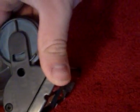And just a little note, I figured it out pretty recently. I think I know why Dyson uses Torx head screws instead of Phillips head screws. It's because if you have a Phillips head screw and that head gets stripped, it's pretty much worthless. You can't really do much of anything to it. A Torx head screw, if it's stripped, just pretty much becomes a hex head. So you can just take an Allen wrench or a hex key, and you can still unscrew it.